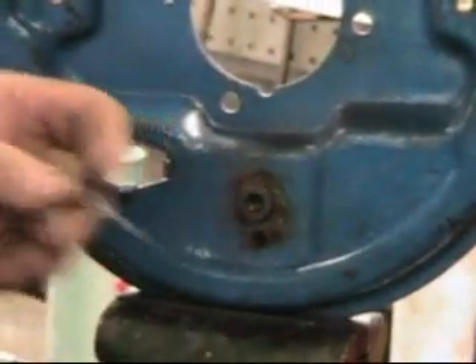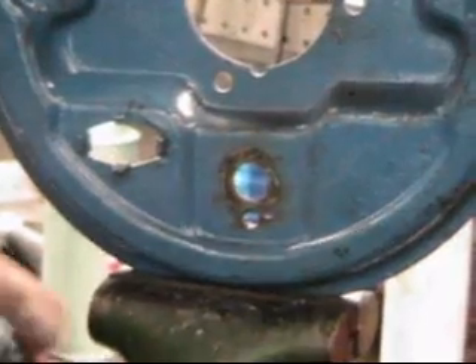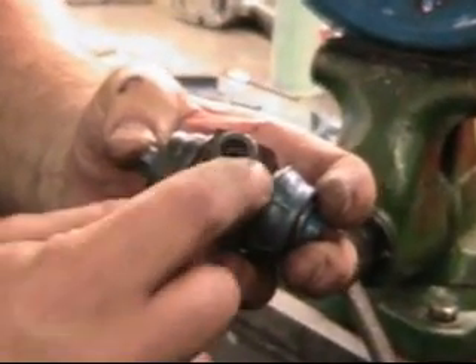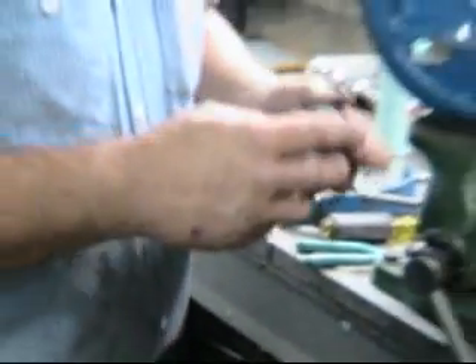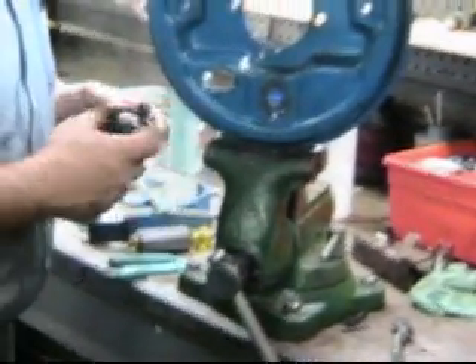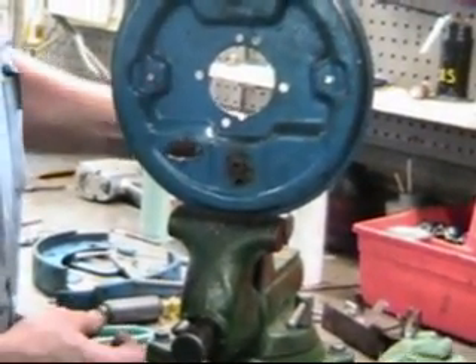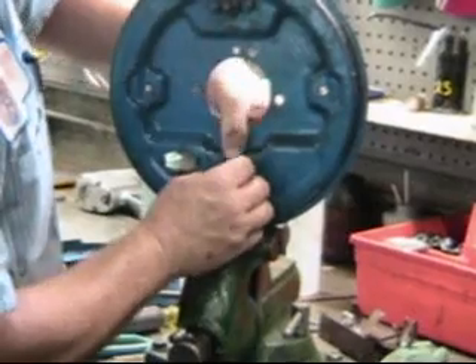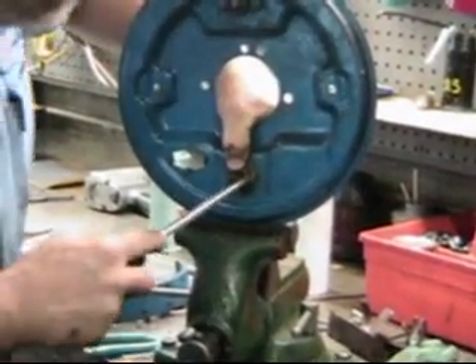Now Andrew's going to focus in here. You see this pin on the side? The pin can be high or low or left or right, and that designates what the diameter is on the inside of the piston. Some are very large on the inside, some are very small, depending whether it's a Midget 1500, a 1275 Midget, or an MGB. You have to have the correct cylinder to go with the correct backing plate. This changes sometimes if you put a backing plate from a GT onto a Roadster, something like that.